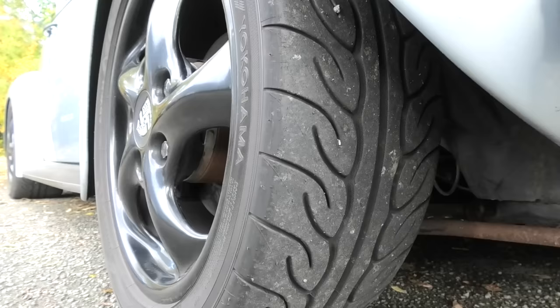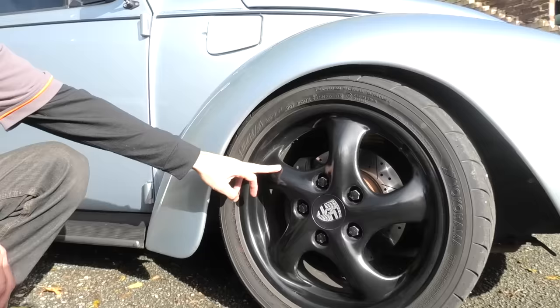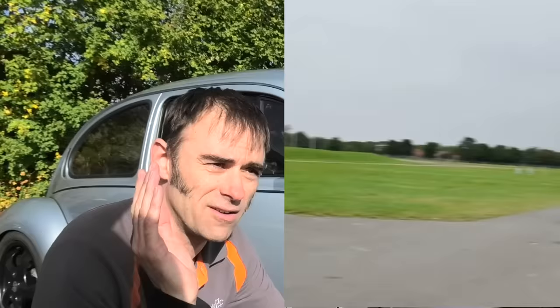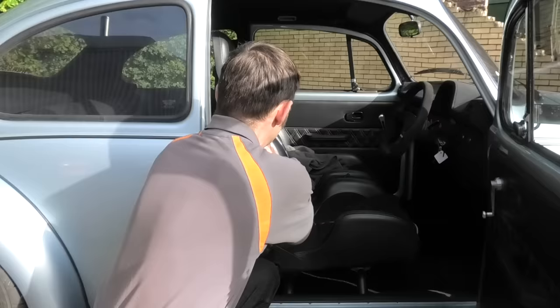You can spy some Porsche brakes and Porsche wheels on there. You've got to have wide wheels — 600 horsepower with original Beetle wheels and tyres would be hilarious and frightening. We've got Porsche 997 brakes on the front, and wheels off a Porsche — probably a Boxster or something — seven inch on the front and nine inch on the rear, with Yokohama tyres which have seen better days because I've ruined them with traction issues. The seats are beautiful — carbon fiber with aluminium frames, lightweight and adjustable.